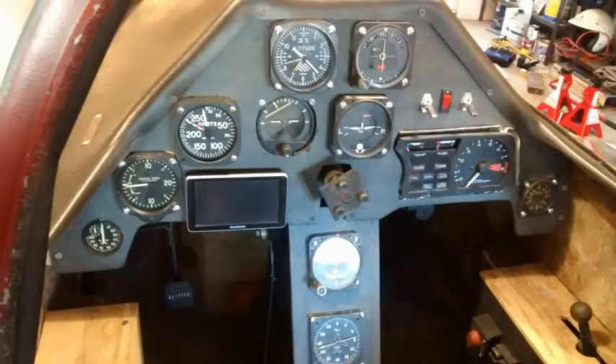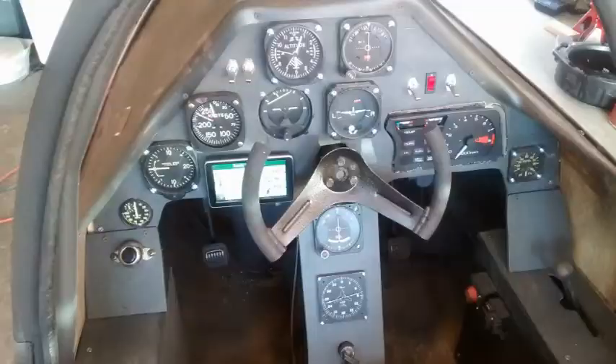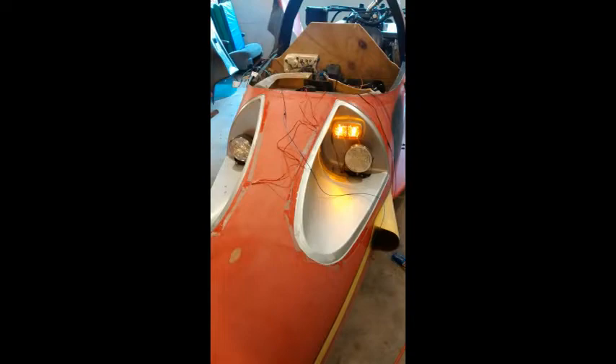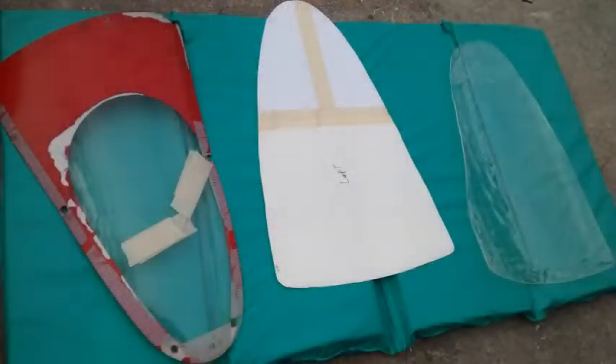Fixing and mounting things, testing, putting in a new wheel and steering — finally getting it somewhat finished. Added new electrical up front, a new brake master cylinder and brake parts and lines, and new lights.